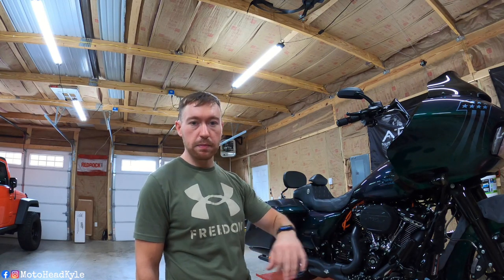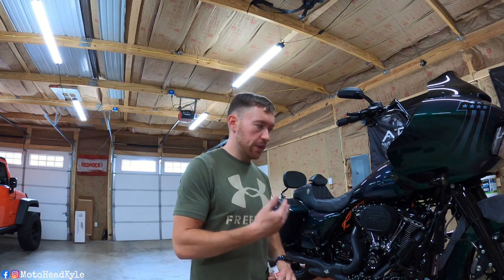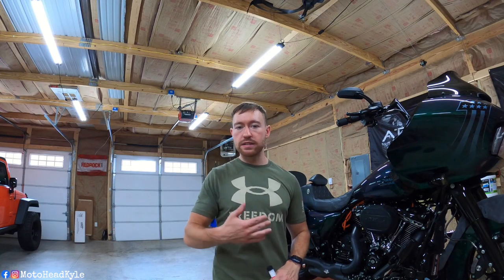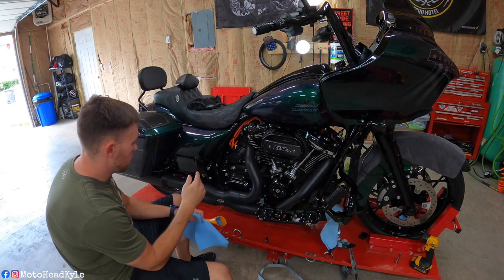Look over my tires, make sure they're wearing fairly evenly, make sure I don't have any screws or nails in the tires. Also, make sure that I don't have any cracks or dry rot starting anywhere. And with that as well, check your wheel, make sure you don't have any corrosion or something that's starting to get a little bad, because that might be a problem down the road. You might lose air more drastically in your tire if it's not seated right because of the corrosion.